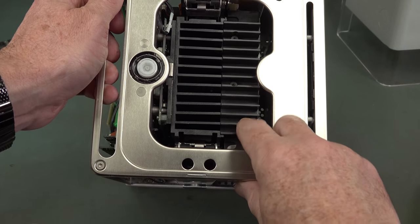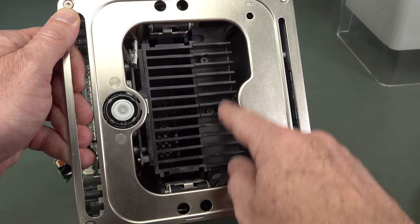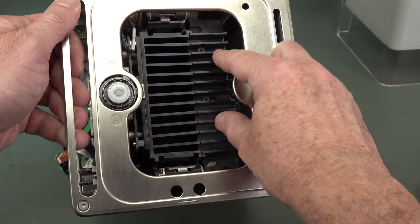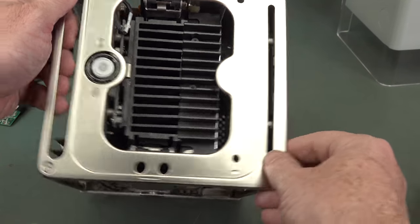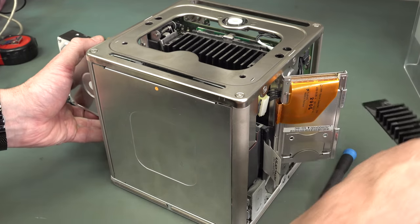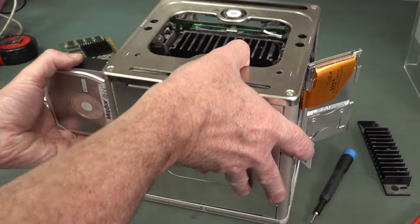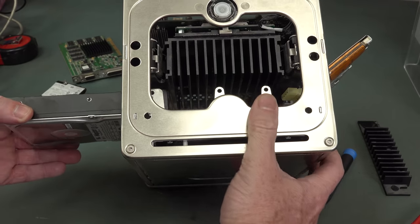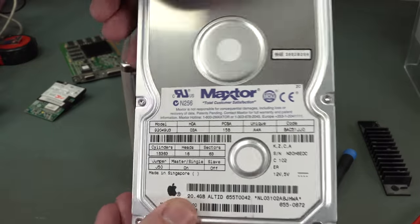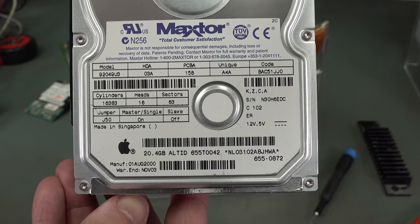There's just a separate top heatsink there to take the edge off - but of course the fins aren't in the right direction for convection, just adding some thermal bulk and fins helps. But the hard drive actually doesn't come out with too much of a fight - you just take the heatsink off the top with three screws, and then the hard drive just slides out of the cage. There are no screws in the bottom side, just three screws in the top side. And this is the tight-arse 20 gig model.